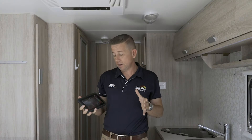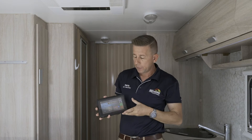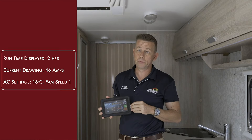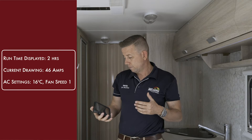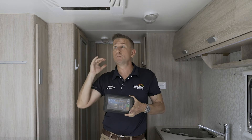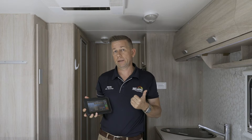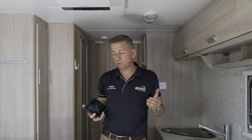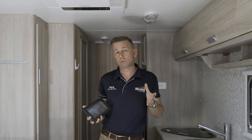As it's slowly starting to ramp up, we're starting to get cold air - we've got 30 amps. Now what a Harrier will do, we've just jumped to 46 amps and you can see we're only showing two hours run time. So you may be thinking he's only going to get two hours out of these batteries, but the truth is once this comes down to temperature, if we monitor our actual temperature setting, we can get this thing to run right back at about 20 amps, which would give us up to five to six hours with this system.